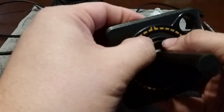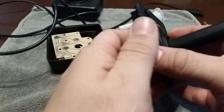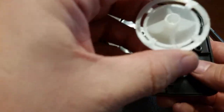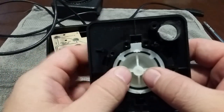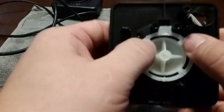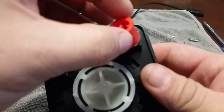Now push on the ring to get it back in place, working it through the rubber if needed to get everything seated. Next, put this plastic joystick piece back in there — make sure this long part is at the top; that's the way it goes in. When I took this apart, this was in the wrong position, so whoever did this before didn't properly put it back. Get your button and put it right back in there.